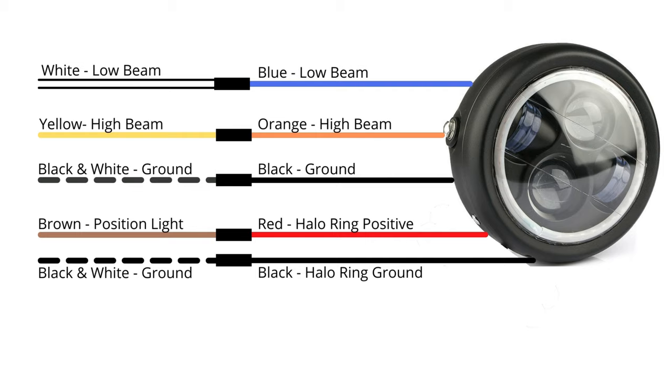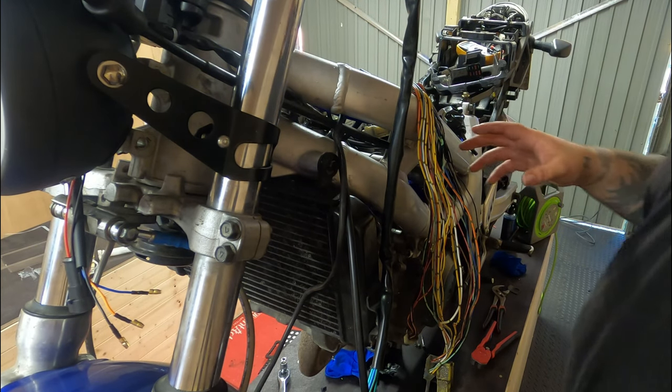You can stretch this out to any bike really when it comes to doing stuff like this, as long as you have a wiring diagram. That's probably the easiest way to find your starting point. Another thing I'd suggest you should have is a multimeter — you can pick them up quite cheap, I'll drop a link in the description. So you can double check everything — go around and try and find your 12 volt connections, turn your lights on, try and find your 12 volt for your lights, turn it off again, make sure it drops to zero, and you know you're in the right place.